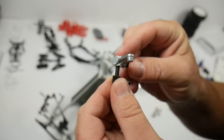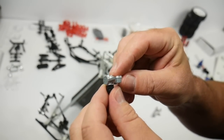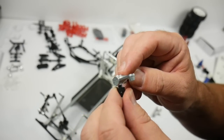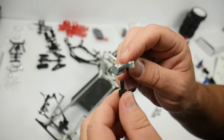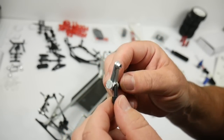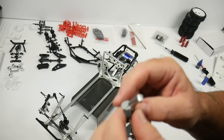The manual mentions putting oil on this little joint, but I decided to use the grease that came with the kit. I think grease is a better option because it's going from cast aluminum onto a steel piece — kind of like MIP drive shafts, same type of thing.